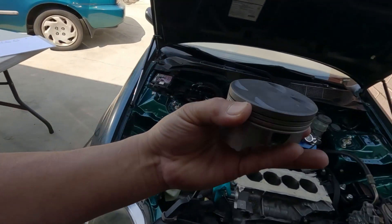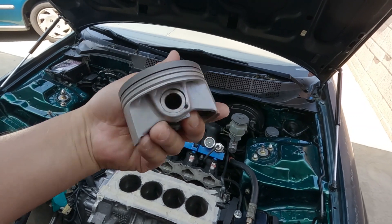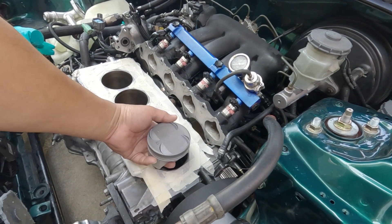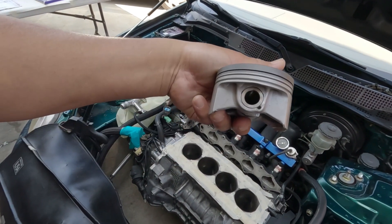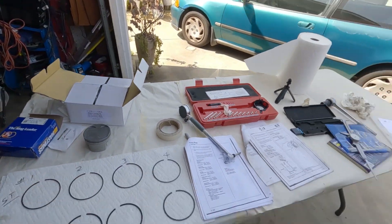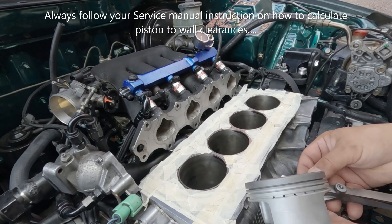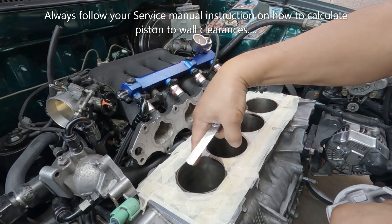What I'm going to do, I'm still going to place this piston with the offset like an F23 piston. The intake relieves of this K20 piston will be facing the exhaust valves. I still wanted to do it that way because of the wrist pin offset, so it will be a good experiment. I really would like to know what's causing the issue. Piston to wall clearance - this is a quick check. Remember that there's a difference between the bottom and the top part.